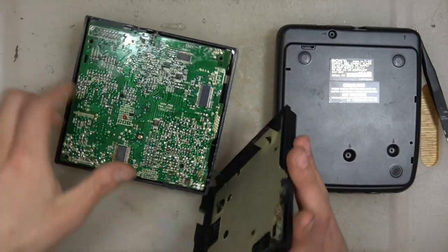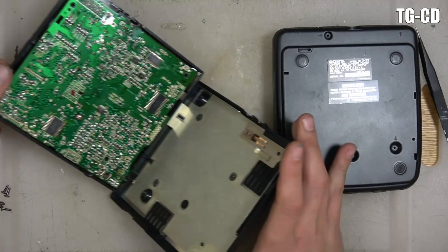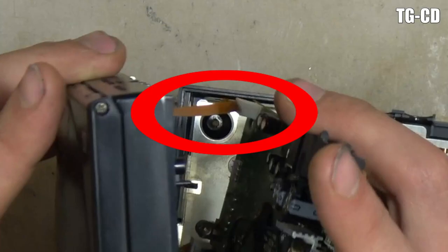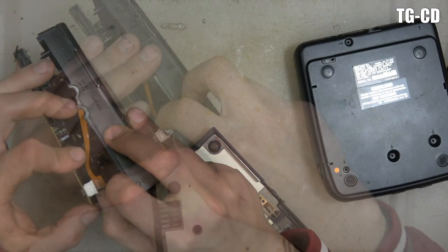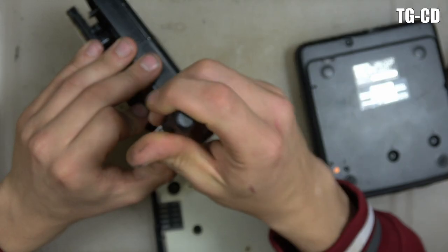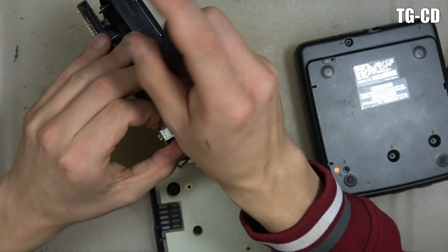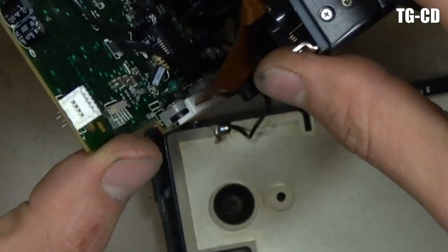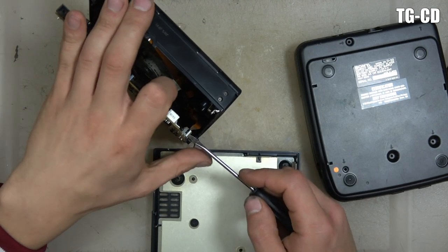Pretty much just remove any screw you see, and right here on the bottom there's a grounding point for the TurboGrafx CD. I'll show you a better angle of that as we move on to the ribbon cable. That's the first ribbon cable you're going to have to remove. With these you don't actually have to pull off the whole top connector — you can just slide it up and then pull the ribbon cable out. There's also an additional ribbon cable, and that is the grounding point I was talking about. It makes your life easier if you just desolder that so you don't have the bottom piece hanging around.